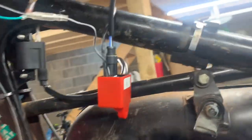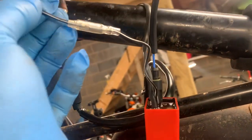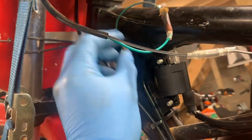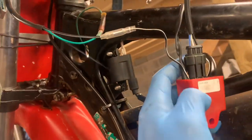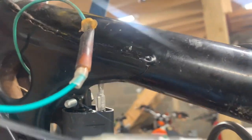We've got it wired up. The plug coming out of the stator goes up and connects into the CDI. The black and white wire goes to one of the kill switch wires; the other kill switch wire goes to an earth point. There's another wire out of the CDI with a spade connector that attaches to the coil, which mounts onto the frame.